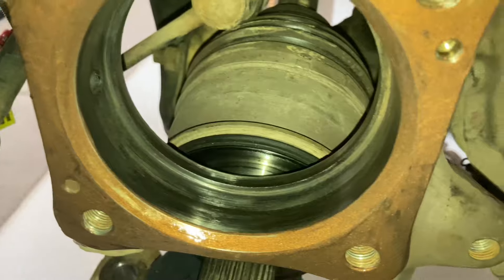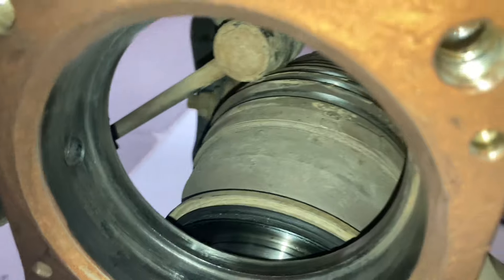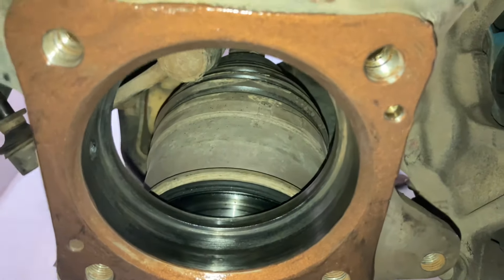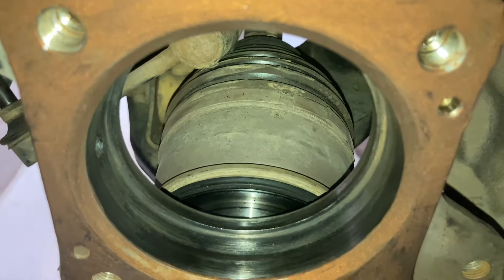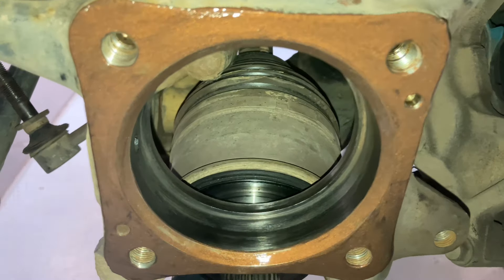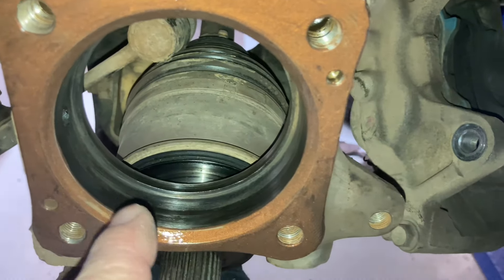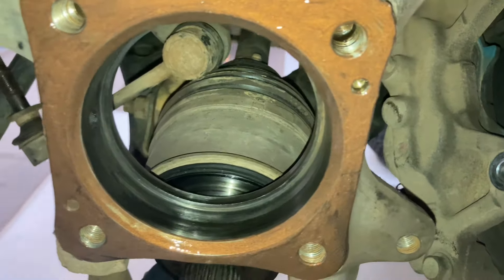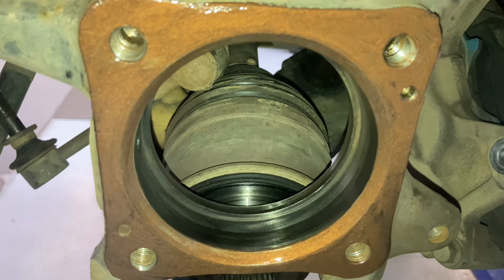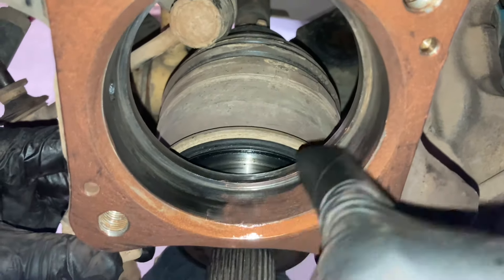If you can do this surface as well inside there — the seal's going to go in there anyway, it's just going to help it slip in. Super light. Just enough so there's some sort of smear there to help with corrosion, particularly at the bottom. On this one, because it's someone we know and we're going to see the car again, we're going super light coating as thin as we can on the rest of the surface — even if it's not fully covered in copper color, as long as there's some smear there. Beautiful.